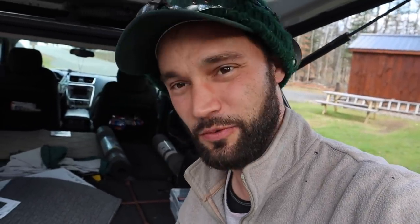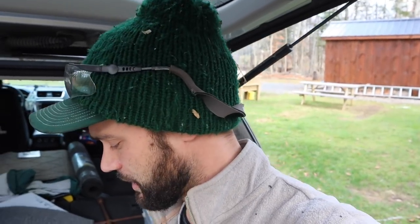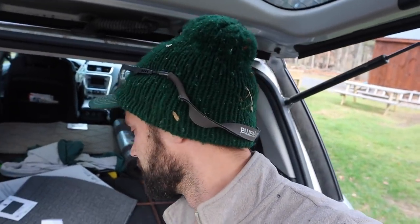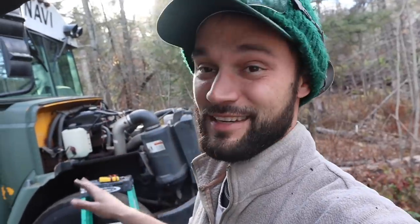Three new batteries. I'm going to let you know exactly how much they cost: $518. Welcome to bus life — it's like filling your oil tank for the winter. I got the records on the batteries. They were running 250 cold cranking amps out of a thousand, then 600 out of a thousand, and 420 out of a thousand. They all showed technically good on recheck, but one was completely dead and another was only running just over 55%. I just opted to replace all of them. We're going to hope that the bus starts, and if it doesn't, we'll start looking for ignition power to the starter. Just trying not to throw the kitchen sink at it just yet.